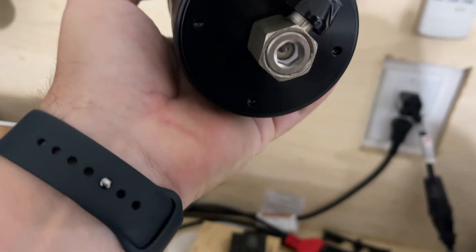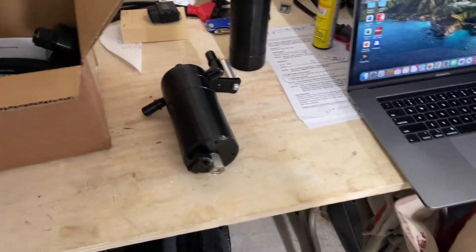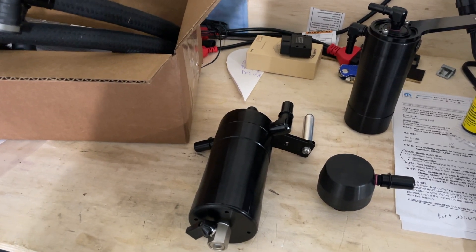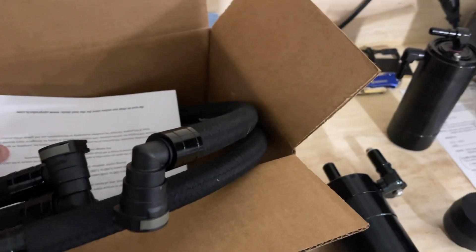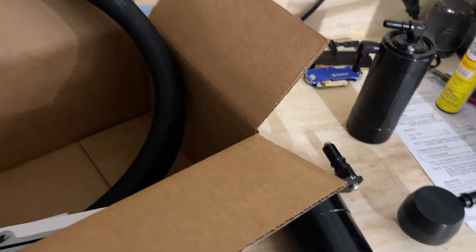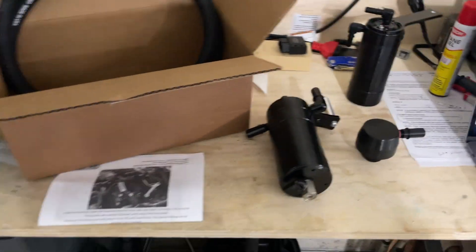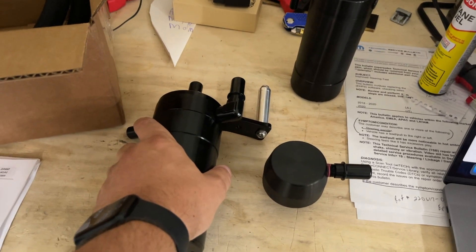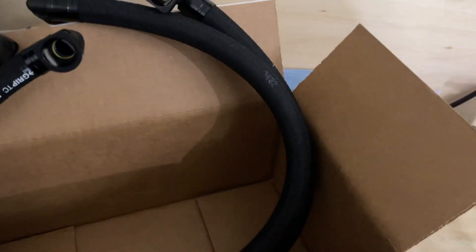It's got a nice drain at the bottom here. I'm going to remove it to drain it — I like being able to remove it and drain it. I don't drain it in the car, so I won't be doing the drain line. This is the dual valve oil catch can with ECSS, it's a plug and play kit. They just changed this kit up about four or five months ago and made it a no-drill install. With ECSS and a wide open line, you can still get air drawn through and it can still be collecting oil even while the system's under boost. It also comes with a clean side can because it's a complete kit with all the hoses, lines, and fittings.